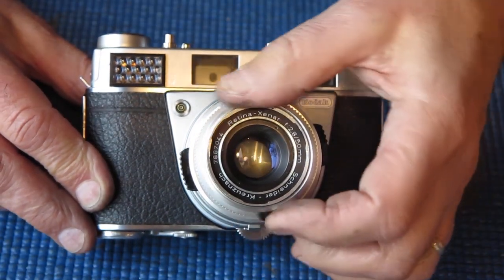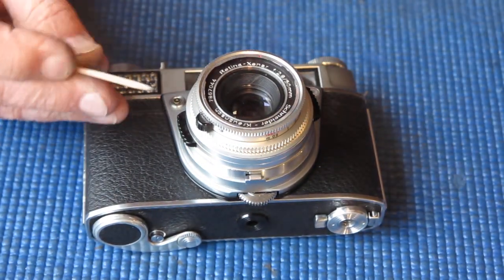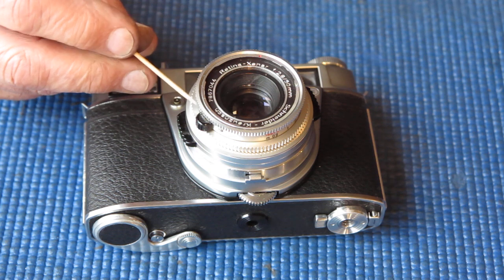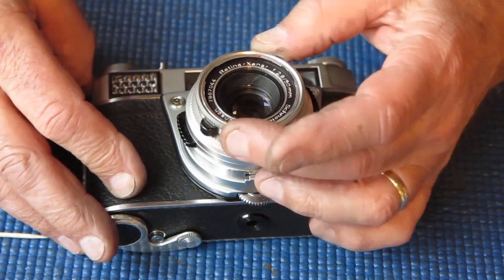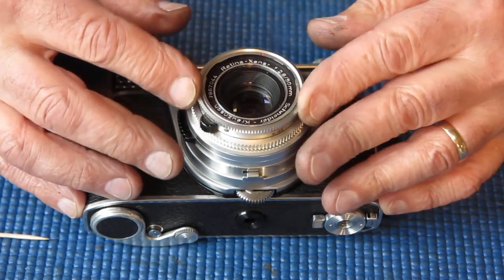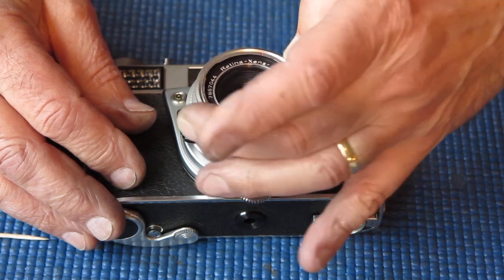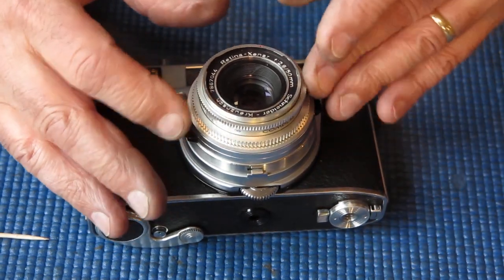Well, it's all together. I'm happy with the feel of that now. That problem with the lens, yeah, that was entertaining. You might remember I said that there was a small screw that was the post for the fine spring, which I didn't really want to disturb because it was a problem to get the spring off safely, and it was a problem to deal with that tiny screw. That tiny screw had worked its way loose, presumably when I was swinging the sectors around in order to get the lens assembled, and as a result the sector that it was holding, that clamp, had shifted, and it had shifted so that it was grinding. The corner of that sector was dragging in the aluminium, so it was making it rough.